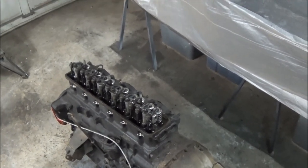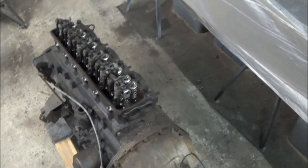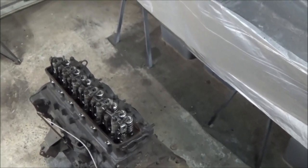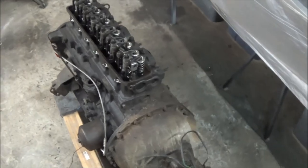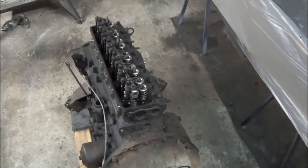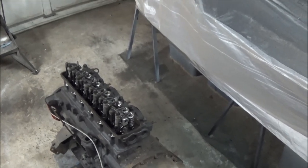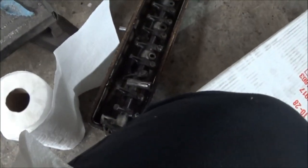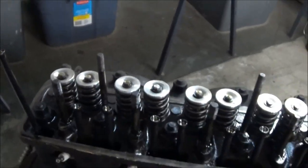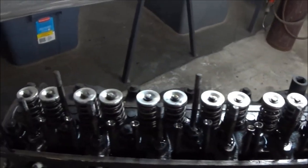Actually I lied — I'm not going in yet, it's only 9:10. Without involving the engine crane, I think we'll take that rocker shaft off and loosen the head bolts, because I know this head is going to be a pain to get off. We'll just have a seat on a milk crate and work nice and slow — remove the rocker shaft and all the pedestals safely and put them in a safe location. The rocker shaft is off, and we're now removing the push rods. We've got a little box with numbers at the front of the engine so we're pulling number one first, keeping everything in orientation.